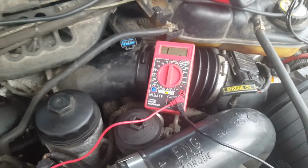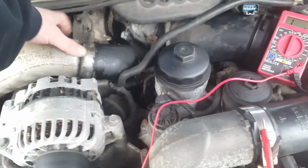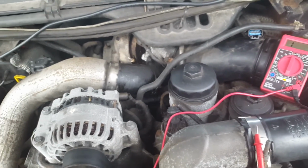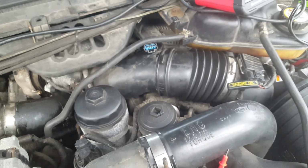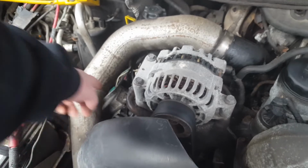Like I said, you got connected there, and you follow from the glow plug module. You can follow where the other one is. It's right under here, under this. But you can check that side, but that side's not giving me any codes, and it's only this side, and both sides are done. Both harnesses are done, so I know the issue is basically the relay, which is these modules, and that's how you check it.